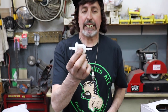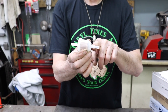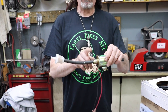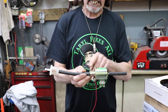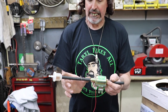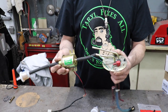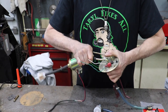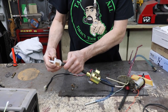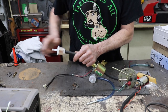You're also going to want to get one of these type of fuel filters, because this fuel filter is quarter-inch on one end and 5/16ths on the other — two different sizes. On this Kazuma, the fuel pump is an automotive-type and the fittings are 5/16ths, so I went to the auto parts store and got 5/16ths fuel line. That 5/16ths fitting goes on the pump, then 5/16ths comes out to the fuel filter, which has an arrow showing fuel flow direction, and then on the carburetor on this Kazuma it's quarter-inch going in.